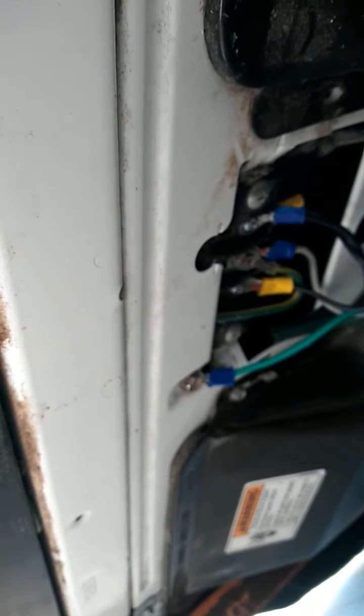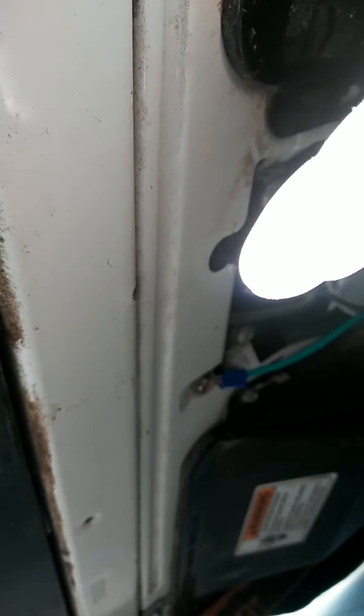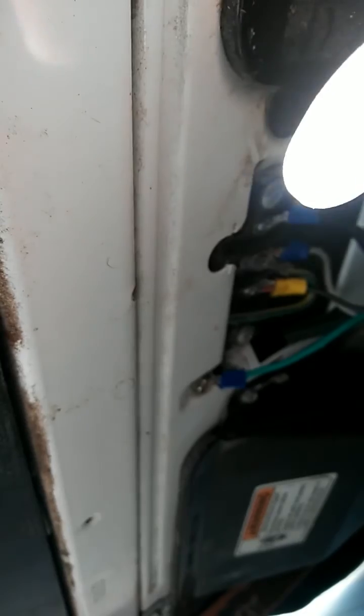So black to the red hot, white to the middle white, and then green from the electrical wire goes to the door in the back of the dryer bolted on. You got your jumper wire — black hot going over to the red hot. This setup actually works really well; I've already ran it like three or four times today. Like the video, subscribe, leave a comment, hit the bell for notifications for more videos. Thanks for your time — you guys have a blessed one.